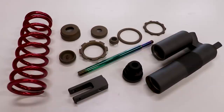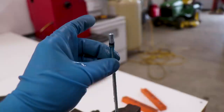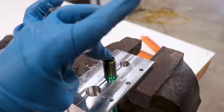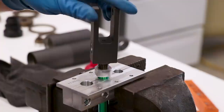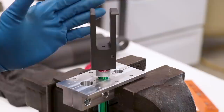Don't go anywhere — we still have the shock to put back together, and man, this thing is gonna be trick. I love that color combo. Step one is to get the clevis back on the shaft. Got the shock shaft in the shock clamp in the vise, and the first thing to do is get the rebound adjuster rod through the shaft. Grease that thing up nice and good, and now the retaining nut can be threaded on. Before I put Loctite on those threads, I'll make sure there's no grease on there — I'll be using the same red Loctite 271 as on the forks. The torque spec for the clevis is around 50 or 60 foot-pounds.